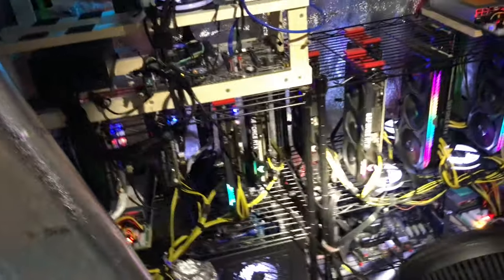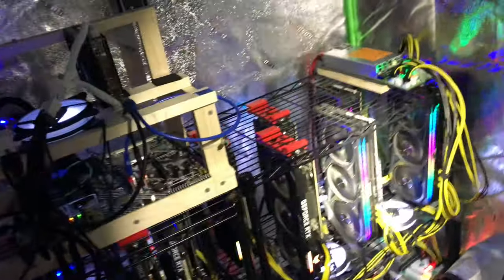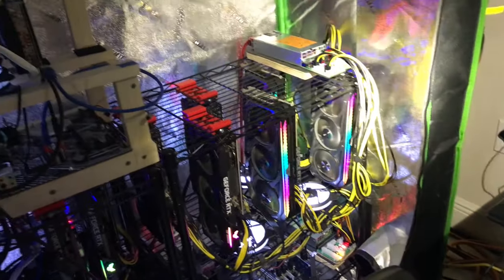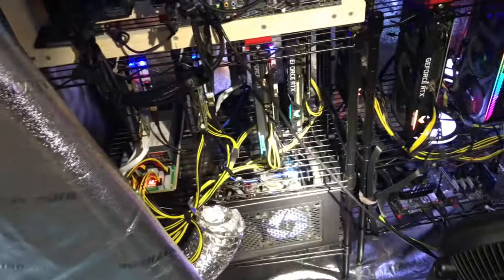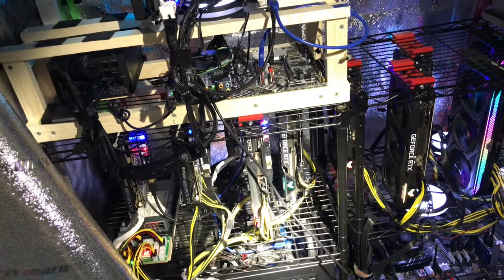Cool air at the bottom works its way up — thermodynamics. The main lesson here: make sure you've got good airflow. This is a residential office and it's cold outside, so I can open the side door and get 65-degree air in. Cons: should have had a bigger rack in here and should have placed the hotter cards to the left where cooler air comes in initially.